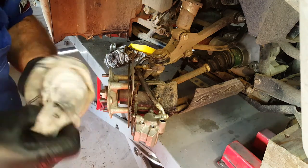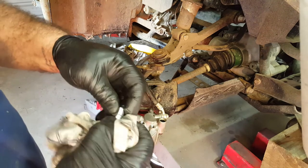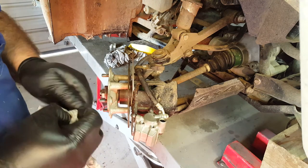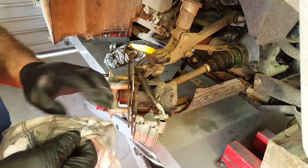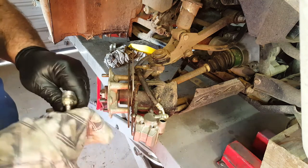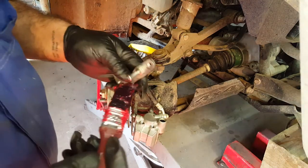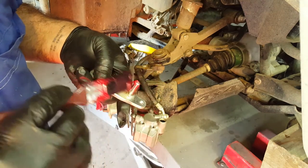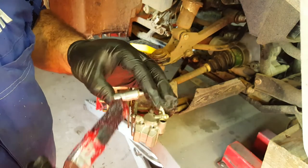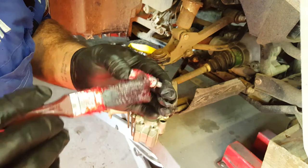Just cleaning off all the old grease from the larger of the two sliders. Now, the thing to bear in mind with these calipers is they don't get as hot as a car brake caliper. On quad bikes you've got quite a lot of engine braking and most of the time you're using the engine braking to slow down, as opposed to the actual brakes. So a bit of grease on the slider — don't flood it, because it'll come oozing out and you'll have to clean it all off, and you can't risk getting grease on the brake pads. Try and fill that central well with grease.